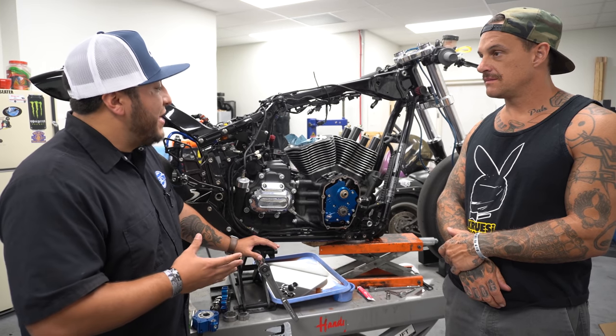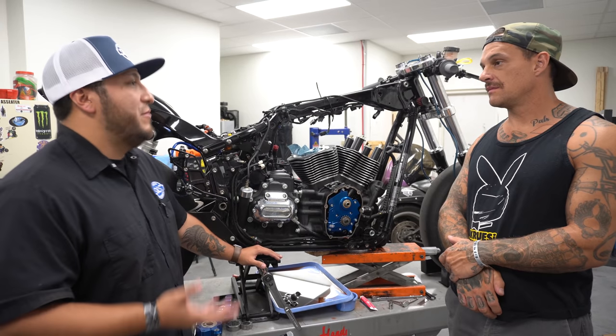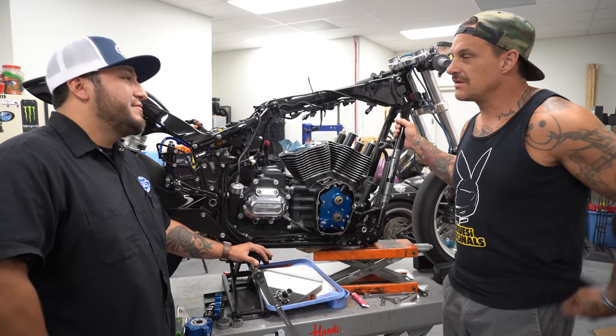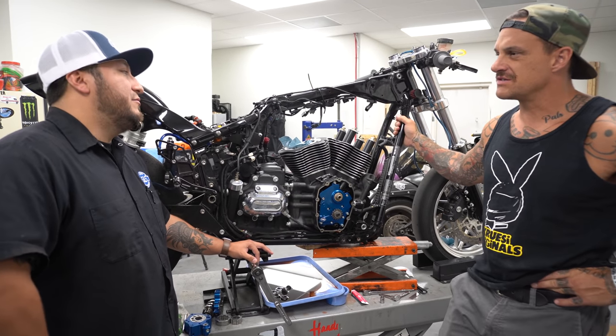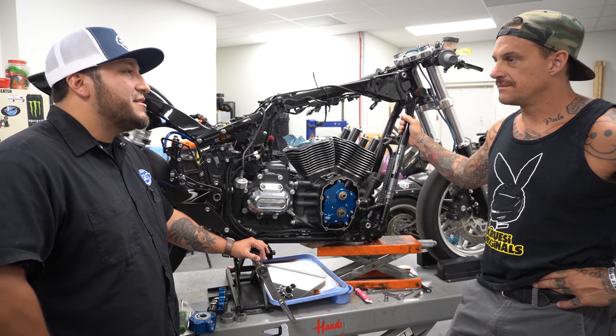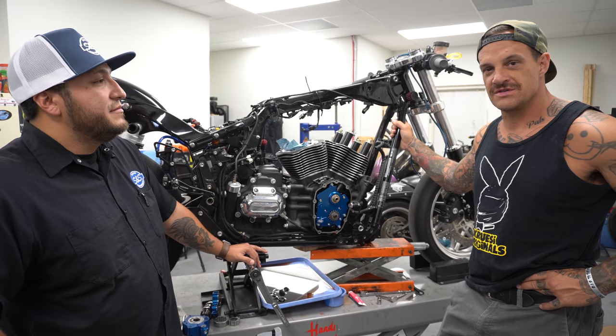The 131 itself, you will be cracking cases for that to run a 4 5/8 stroke flywheel in there, as we do that one by stroke. Really? Yep. Harley's is all bore, right? They're correct. The 131? Or are they just dropping a whole motor in? Whole motor, but it's mostly done by bore anyways. I think about $4,500, you could be in a 140 horse-ish.